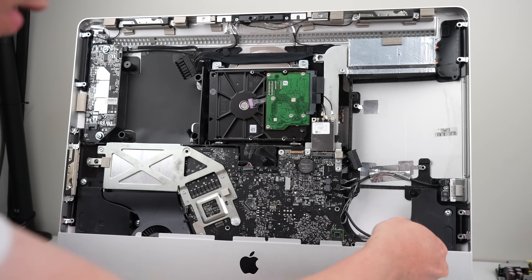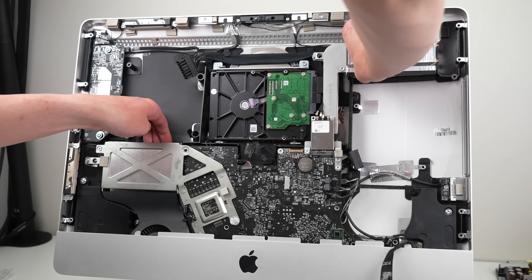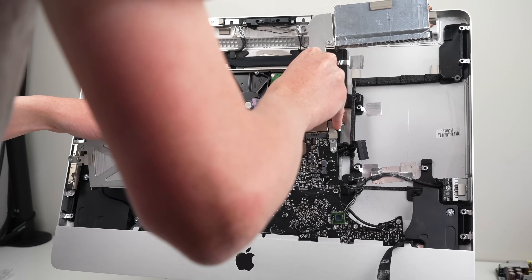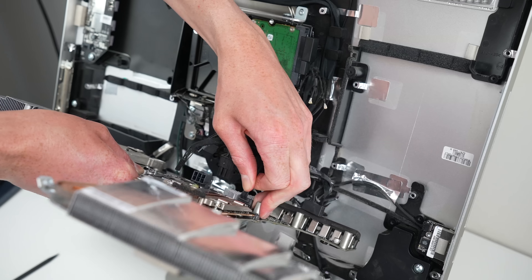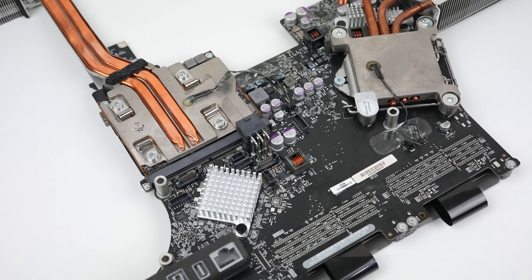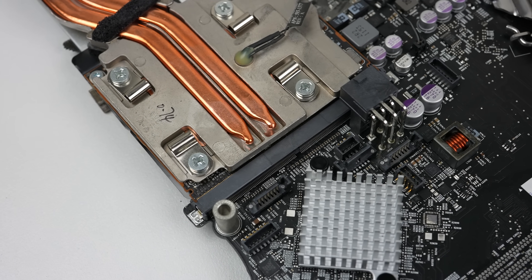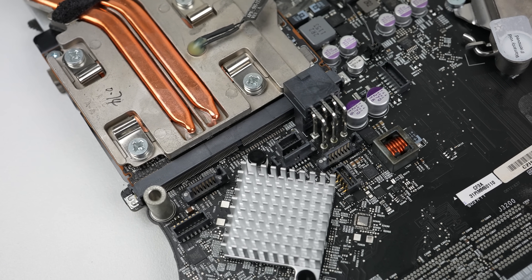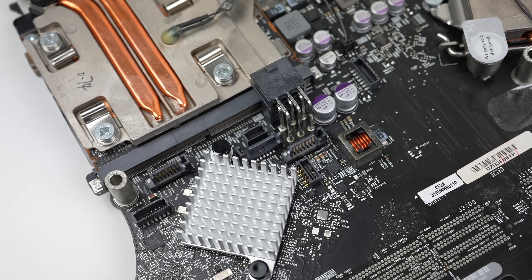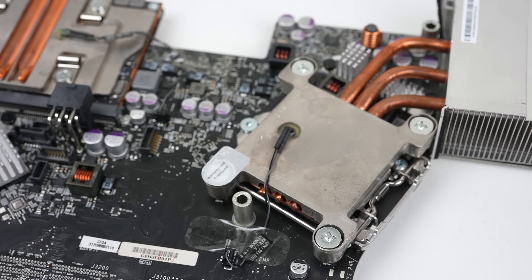The main board sits behind the front chin, so it'll need to be worked loose before it can be lifted part way out. There are still several cables for power, the hard drive, and optical drive still attached to the other side. Now, we can get a good look at the logic board. There are three SATA ports, labelled HDD, ODD, and SSD. Models configured with an SSD also supported a second hard drive — that's why there are three SATA ports. Although mine didn't ship with an SSD or have two drives from the factory, the port is still present and with the right cable, it can be used.